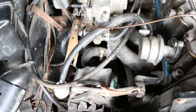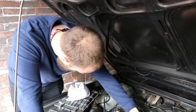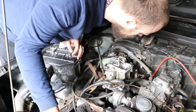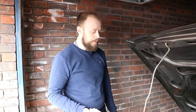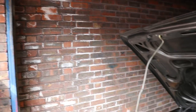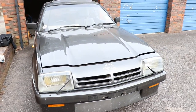The inline fuel filter has now been put on and everything's bolted up. Doing a final once-over: clips back on the linkage, lines back on for the distributor, vac lines back on, coolant's back on — looking good. We haven't touched the idle so that should be okay, but we've had the fuel-air mixture screw out so that might need adjustment. The fuel lines will be dry now so it probably won't go first time — let's see if it just turns over.